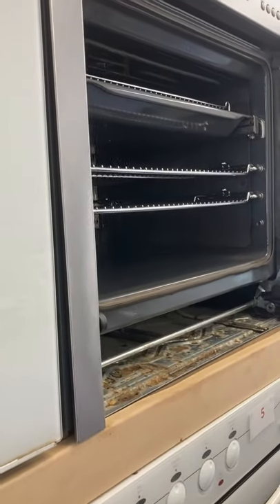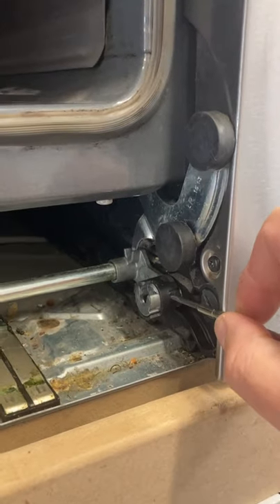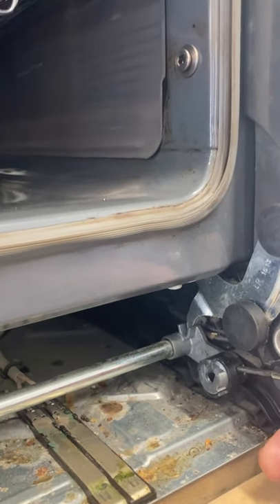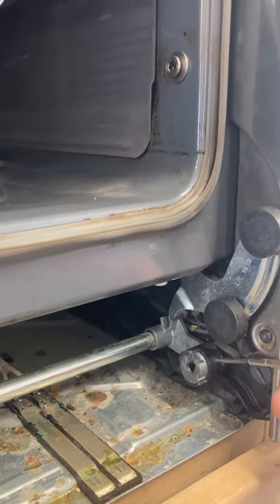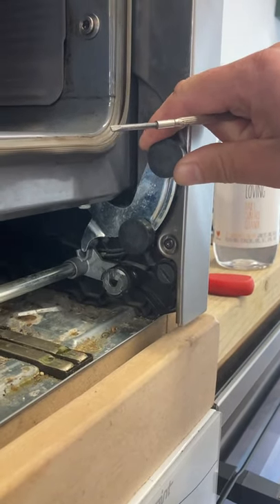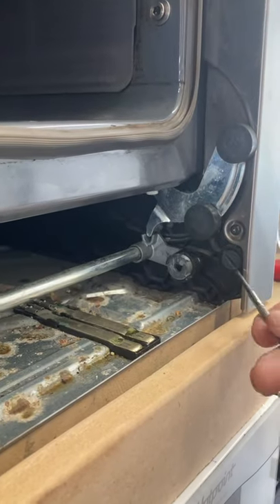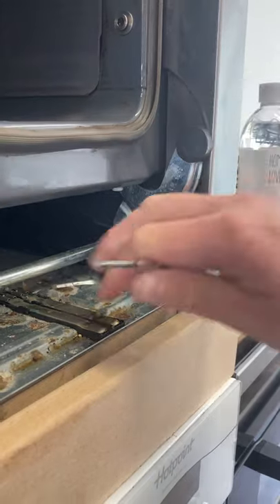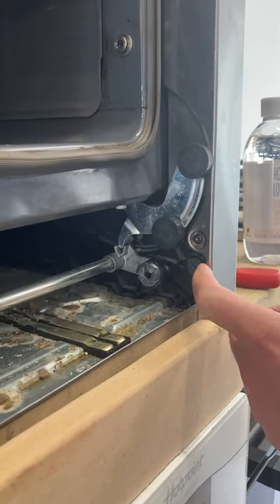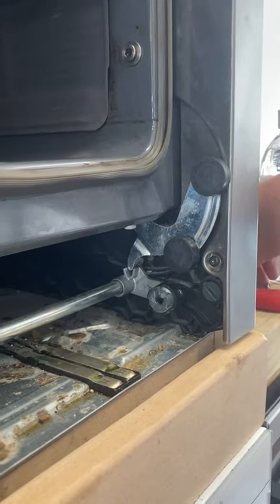So that's the door off. Looking at the mechanism: placing the screwdriver in there and closing it locks the door in place; lifting it up unlocks the door so you can take it off — basically down and up, and that's on both sides. This mechanism locks the hinge stiff in place and also locks this little device onto the bar so the hinge and bar are attached and don't move. If you don't get this part right, it will spring back to the oven and your bar will release — so make sure the door is locked and that screw is pointing towards the oven.